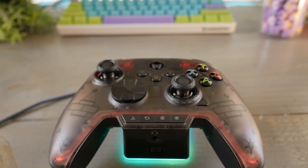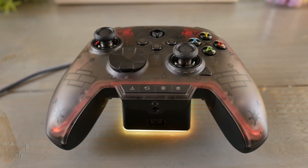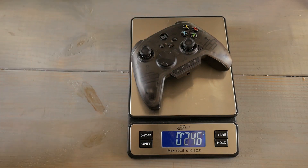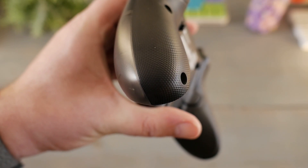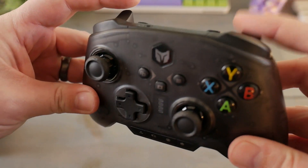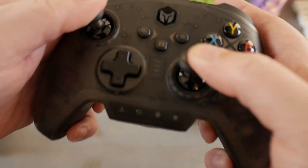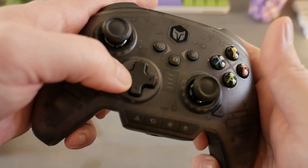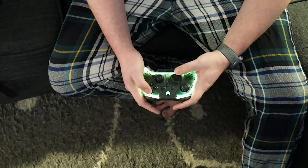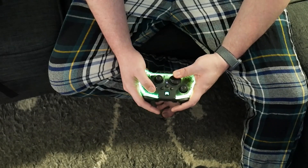The brand name is a mouthful, so we're going to call them BB Dubs. It weighs in at roughly 255 grams, which is about nine ounces, and feels really high-end and durable. The back of the controller is coated with a high quality, durable rubber-feeling material. They use a hybrid array of switches and buttons, which are pretty great, as well as ALP sticks. Before you get too down on that, we'll talk about it — ALP sticks will likely develop drift later in the controller's life.